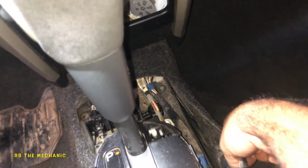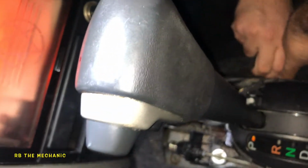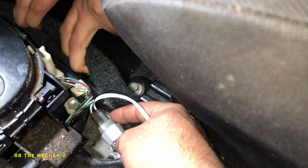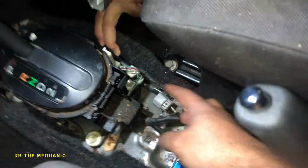Okay. So our oxygen sensor connector is probably most likely down here, and I can see it right there. And oh, can you pull this for me? I'm gonna put my hand in there. No, pull it forward. The whole thing. I'm gonna put my hand down here, and I'm gonna get that connector to come up. But this is the old wire. You see this? The one I cut down there from there, and this is where it connects to. So simply, can you pull on this cable here? Pull the connector. No, this whole thing. I'm getting help from my friend here. You see that connector comes out? So the new one connects to here.